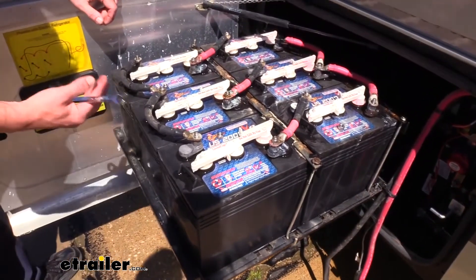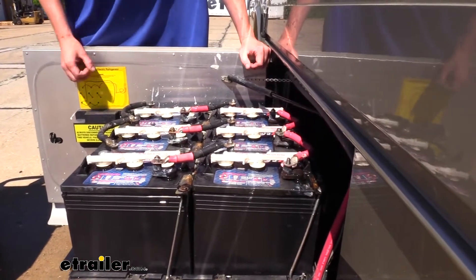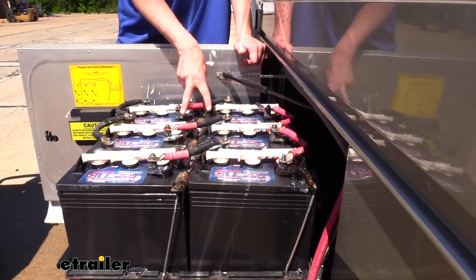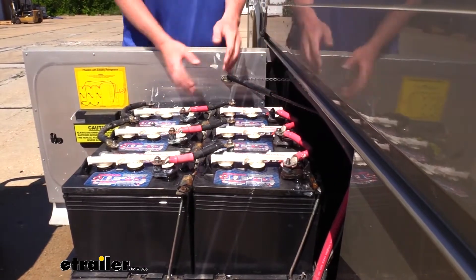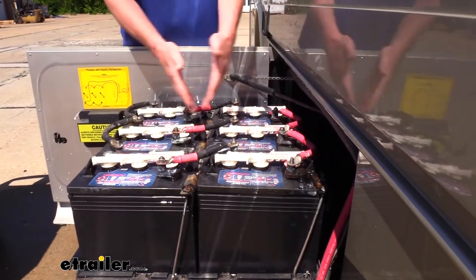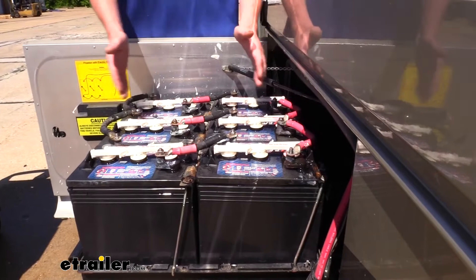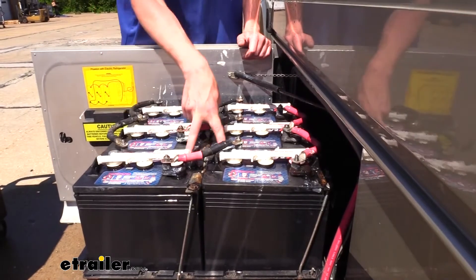Since we are working with a six-volt system, this is what's known as a series-parallel circuit. If you're using six-volt batteries, this is pretty much what you're going to have, because we need 12 volts to run things inside our motorhome. In order to get 12 volts out of a six-volt battery, we wire two in series — putting our positive to our negative — basically making one giant 12-volt battery. Then we wire those giant 12-volt batteries in parallel with one another so they share their capacity. So you've got three pairs of 12 volts if you look at it like that.